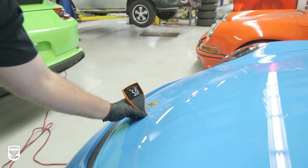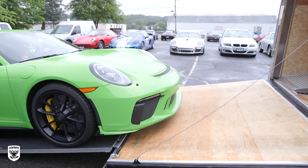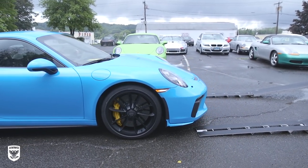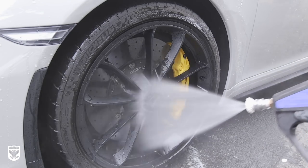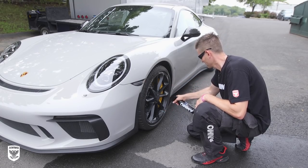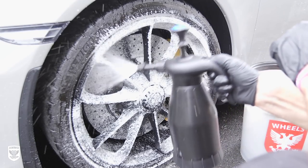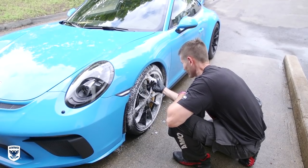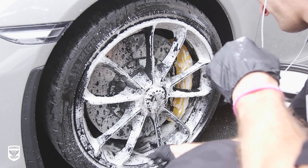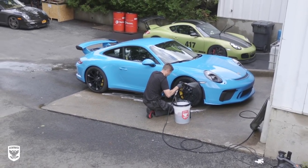Here is what I did on all three GT3s when they came off the truck before assessing or comparing the paints in the shop. First, I focused on the wheels by pre-rinsing with water, then I added some plum, then used brute wheel soap and water in the aerator, along with wheel brushes and wash mitts. I didn't use a foam gun here because I might hit the paint and have it dry before finishing the thorough job on the new wheels. Once done, I rinsed again and moved on to the next wheel.